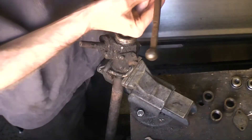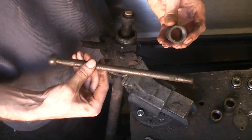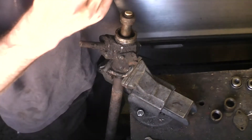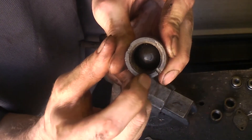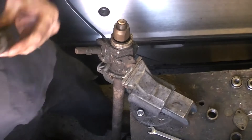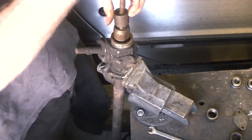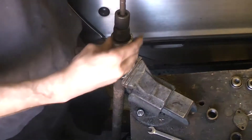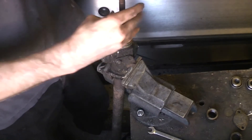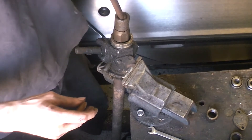You have your tie rod or track rod, and then a completely smooth circular collar that's threaded at one end. You put the threaded end towards the ball. There's a little cut in there — that's actually drilled in during refurbishment or original build. You put the spring in, then the shoe with some grease, then thread this collar on to the point where you start compressing the spring. That gives you your pre-tension on the track rod. When everything's tight it should be smooth and easy to move but stay wherever you put it.